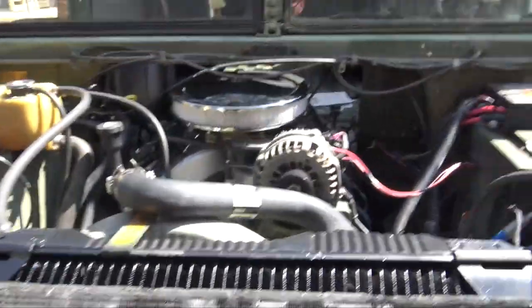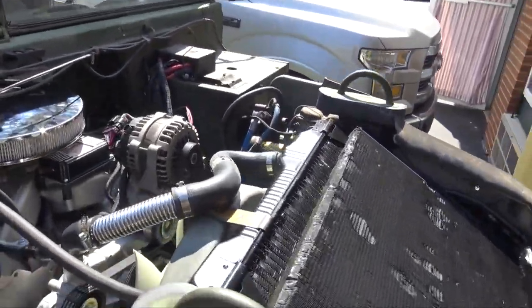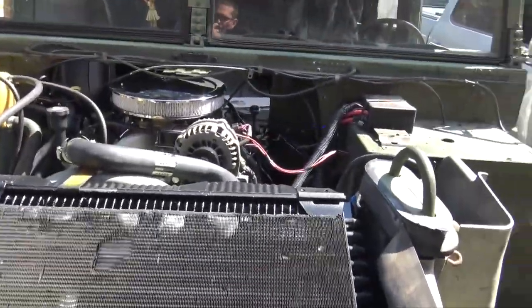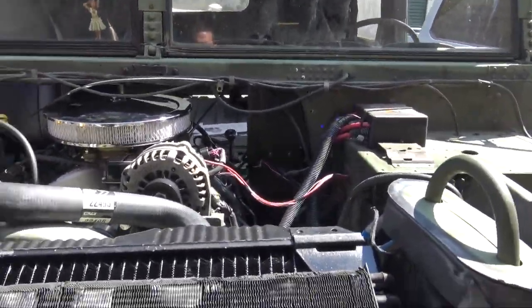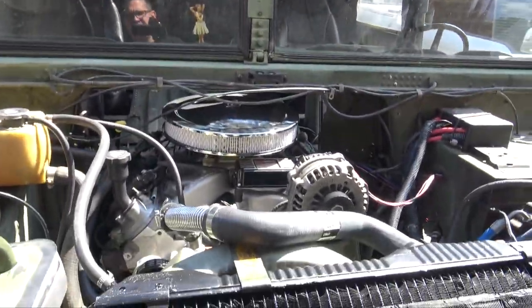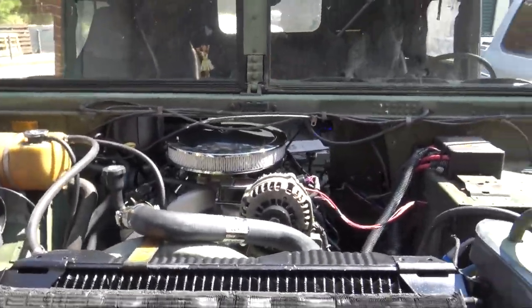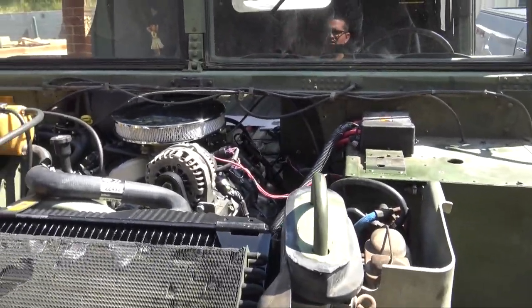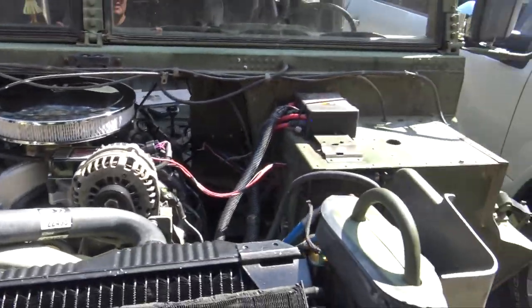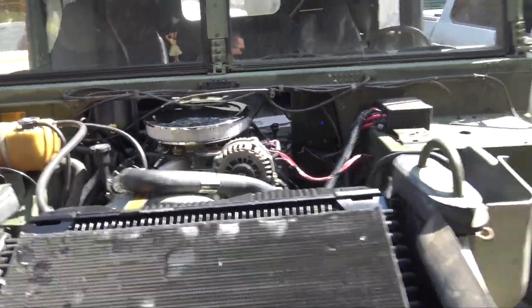I've got to put a different alternator on it because that's a DR44 alternator — it has the two pins, it'll put out a constant 13.8 volts but will not regulate above 13.8. So I'm gonna change that over to an older 2002-style 145-amp alternator. And then you can see the upper radiator hose which is an absolute mess, but it's what it took to get it to run. I drove it over an hour and a half. It's got the MSD box and some wiring that needs to be looked at.